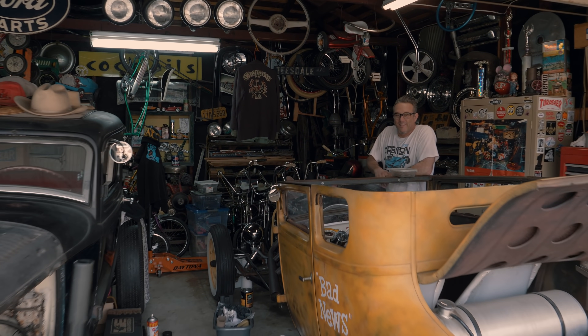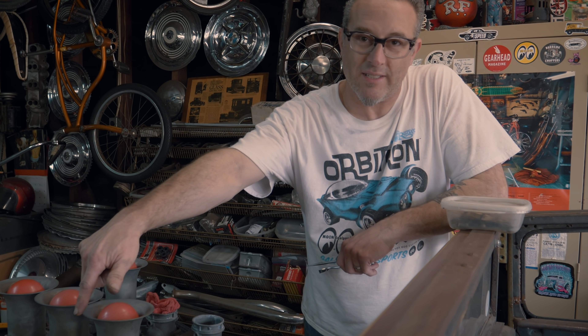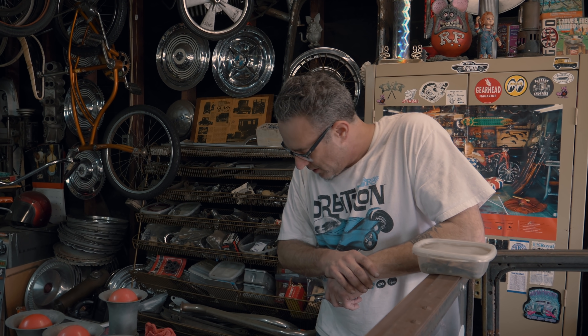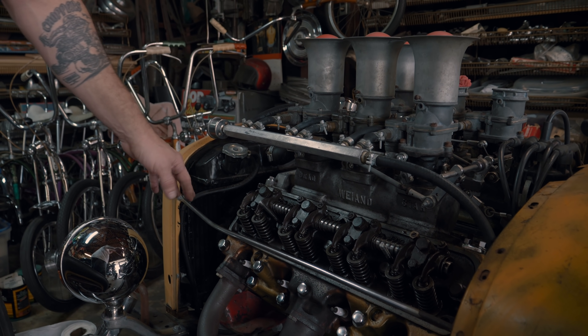All right, dad — do you have an update on what's going on with Bad News? Is it going to make it to the drag race? I'm not sure at this point. Basically there was — I don't know if it's a head gasket leak — but I drained the oil and it looked pretty good. I took out the plugs, turned it over, and a little bit of water came out of a couple cylinders. The original problem was we saw a little bit of coolant coming out of the headers. Anyway, I re-torqued the heads to make sure they were torqued down properly and they were actually a little bit loose, so I tightened those up. I also inspected the rockers and there was a little bit of surface rust in there, so I cleaned all that.